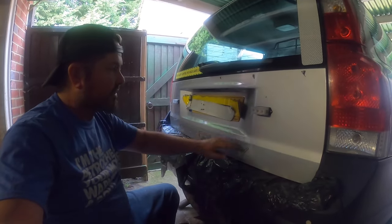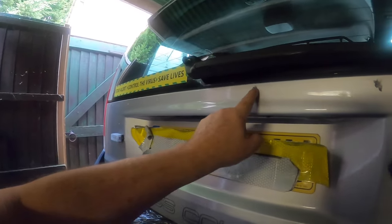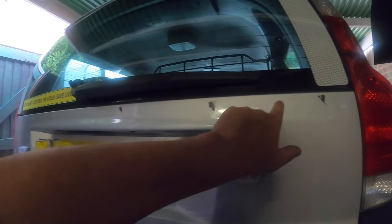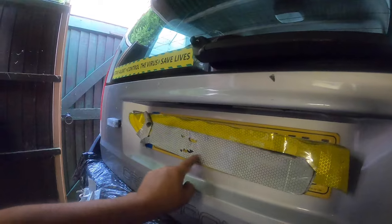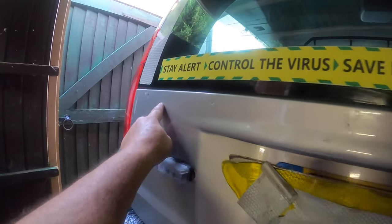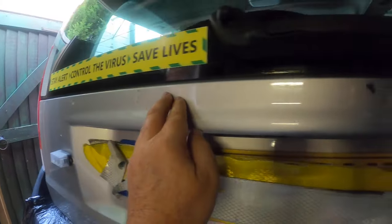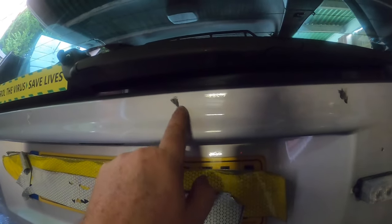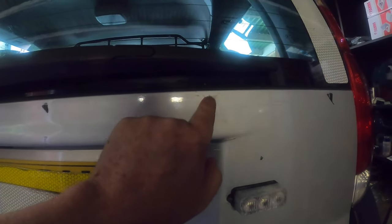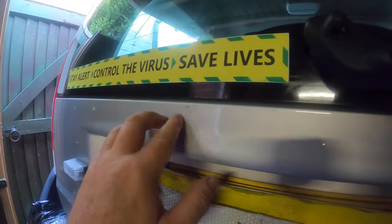It came off very well with the tar and glue remover. The only place where there are marks on the paintwork are where these black smudges are. Now, I don't know what that is, but it is different to the normal Battenberg reflective vinyl that's coming off. And wherever those black marks appeared, they are these scratches or kind of paint marks in the surface of the lacquer. I suspect that these might have been attempted repairs to stop the reflective vinyl peeling off in these places, and whatever was used has actually damaged the paint underneath.